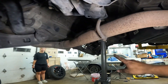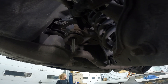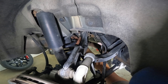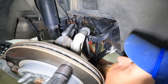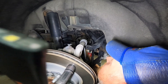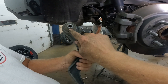I've let this jack down — as you can see, I've got this body bolt out and that one out. I just put a piece of all-thread up through there that I happen to have to kind of help line things up, but I don't think it's a necessity — it just makes me feel good. Here's the bolt we're trying to get out. I've got this lower down, there's lots of room. All I've got to do is lift up on this just a little bit, wiggle that out of there — just enough room to clear — and then we can take this arm out.